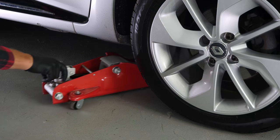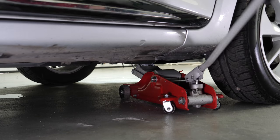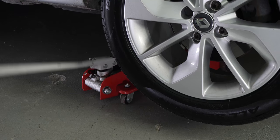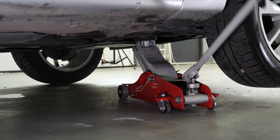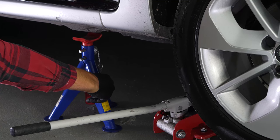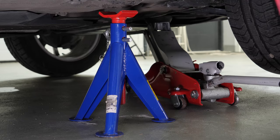In order to carry out the draining and purging on the coolant of your vehicle, we advise you to lift the front of the vehicle to carry out specific operations from under the vehicle. Raise the front of the vehicle and put it on the two axle stands. We strongly suggest watching the tutorial on raising your vehicle safely before carrying out this step.